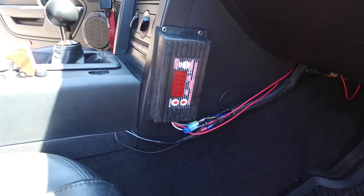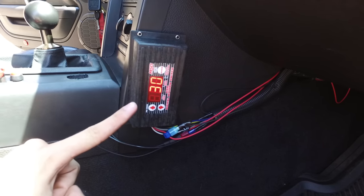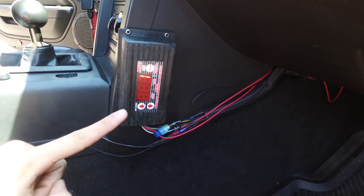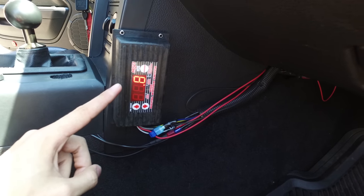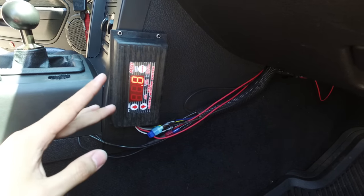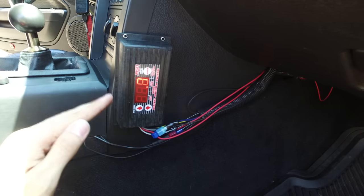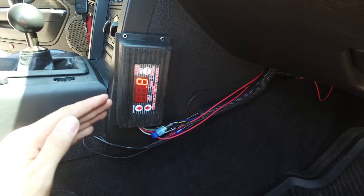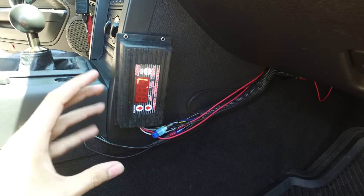I just turned on the car and now I'm going to turn on the activation switch. On the display we see 30 — that's 3,000 RPM. Off is 60 — that's 6,000 RPM. Cylinder 1 is the cylinder I need to be at. The 8 is the RPM my engine is currently running at, so about 800 RPM. So depending on how many RPMs I have will depend on when the nitrous will activate. Once I reach 3,000 RPM it will activate, and once I reach 6,000 RPM it will deactivate. Anytime I lift off the throttle it will deactivate as well. That is basically how the window switch works — it is the safest thing and will control the full system.